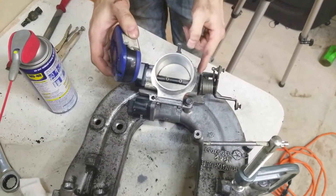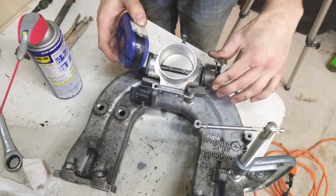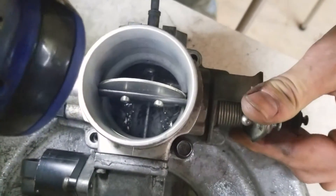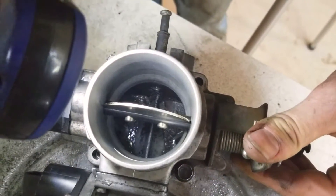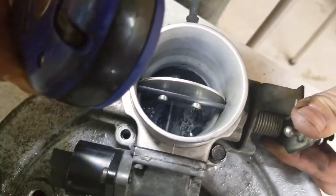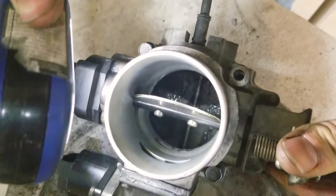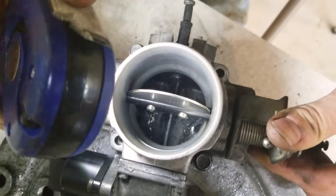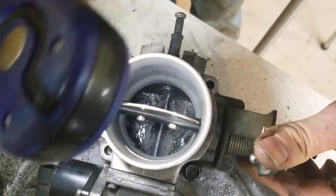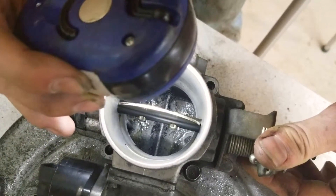So now we have bored out the opening to the intake manifold — let's take a look and see where our restrictions are. Hey, check that out. You can't see it at all anymore, which is way better than before, because before we were hitting a solid wall of aluminum, and that is not ideal. So now we are more ideal. We should have less turbulent flow, so more air theoretically. Guess we'll find out when we drive it.